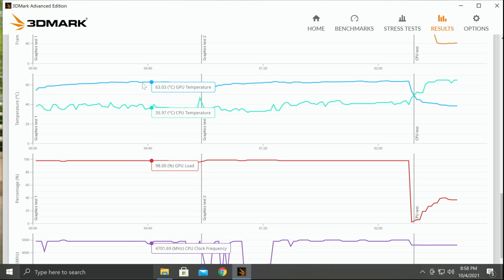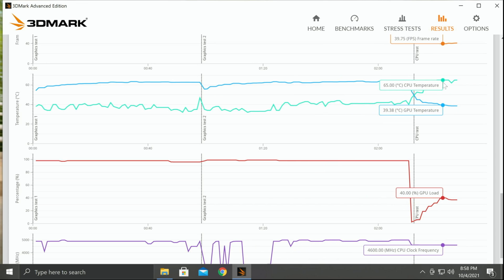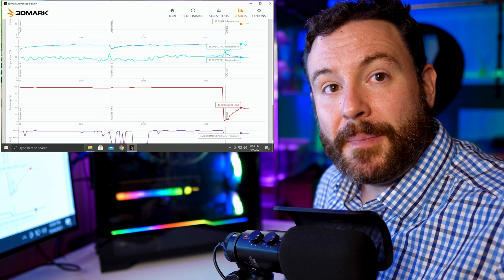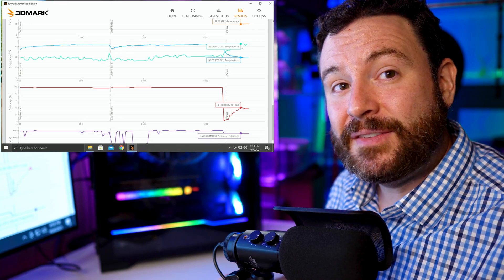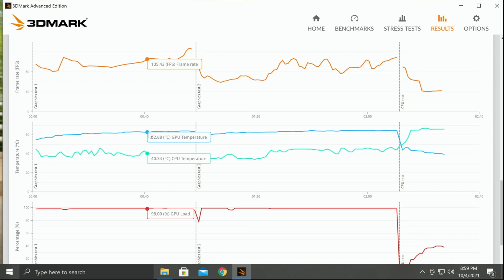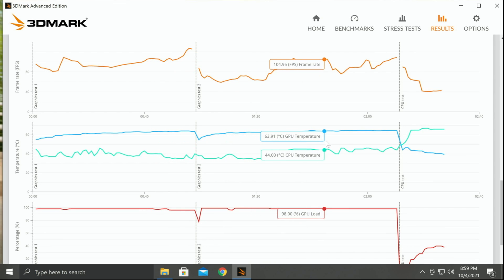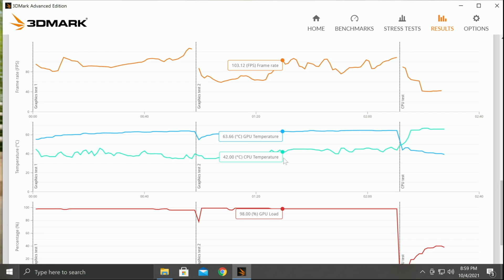Looking at the GPU temperature, I found pretty consistently that at 64°C we had pretty much maxed out at the current stage. The CPU was at 65°C. So what does that tell me? In order to get the great performance we're looking for around 60 to 65 degrees Celsius, these fans need to be really moving the airflow. I compared this to the baseline and found the same conclusion: between 60 and 65°C, we need to make sure the fans are ramping to their full potential, meaning we need a very aggressive fan curve targeting that 60 to 65 full ramp.